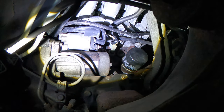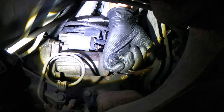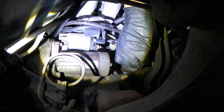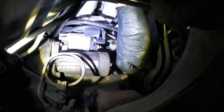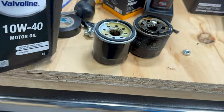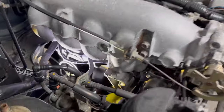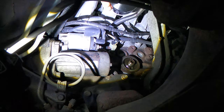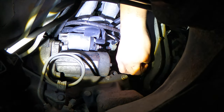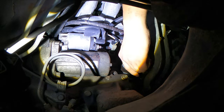Next up, the oil filter, which is surprisingly hard to reach, but luckily wasn't previously installed by the Hulk himself, so at least it's fairly easy to undo. Then the new filter can be placed. I filled it with a bit of oil and used that same oil to lubricate the rubber seal before installing. I found that installing it can be done from the top as well. The advantage of a small engine in a comparatively large engine bay: it makes everything a lot easier to reach.